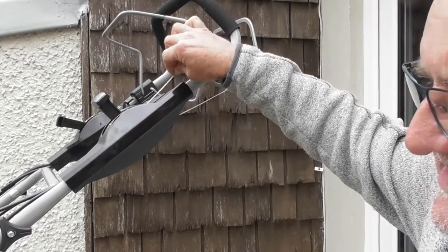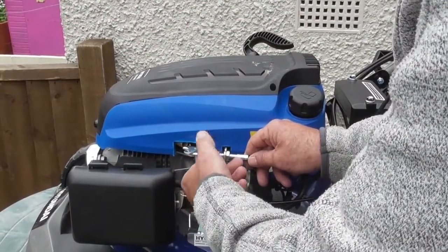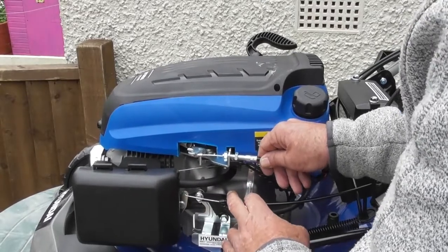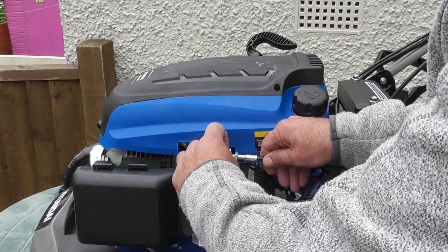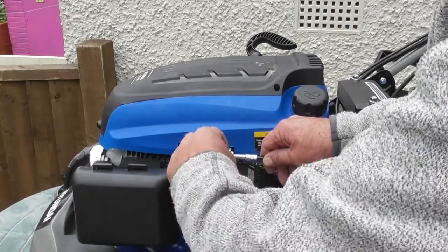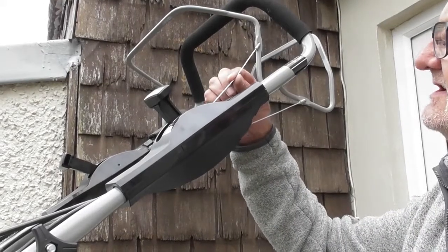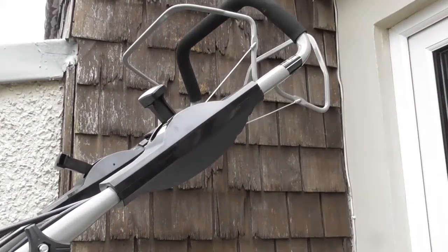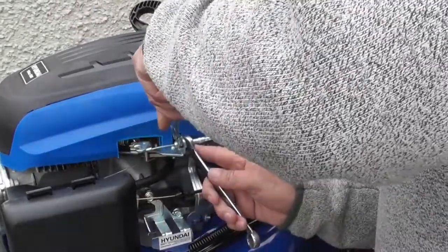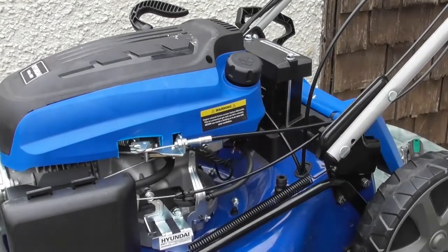We need to do a bit of adjustment — on the OPC cable there's way too much slop. Back down to the adjuster on the side of the engine: loosen the front nut and with a little bit of effort pull the cable backwards away from the bracket until you feel resistance, then tighten the two nuts onto the bracket. I've now got about 6mm of movement on the cable and everything pulls properly — that's the right adjustment. Lock the two nuts off with a pair of 13mm spanners. That's the OPC adjusted.